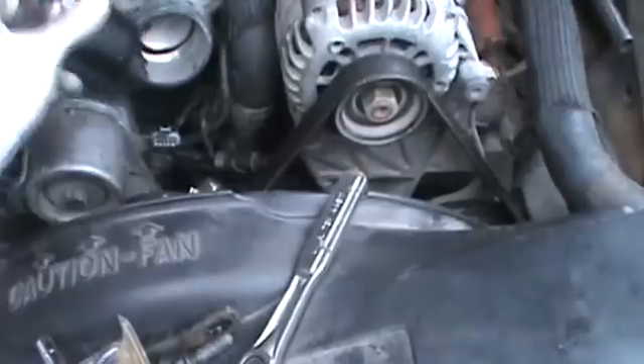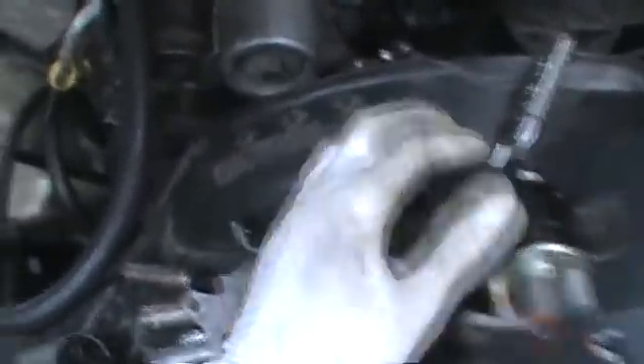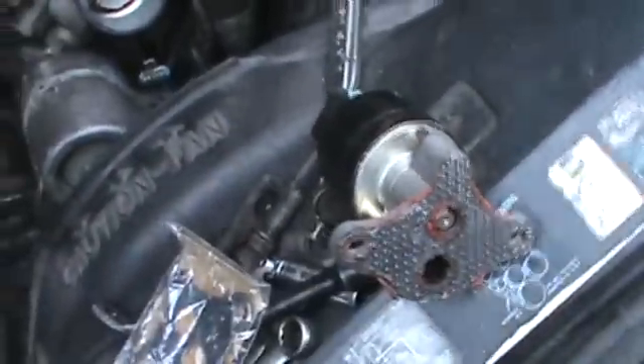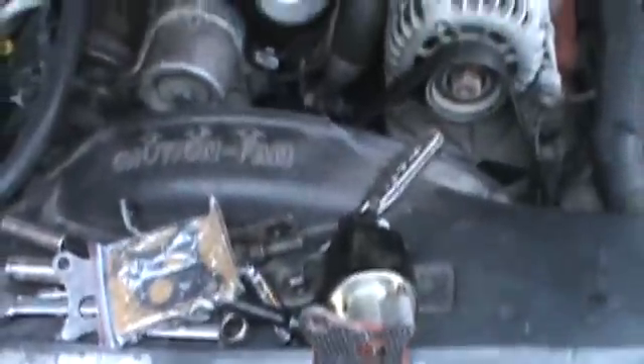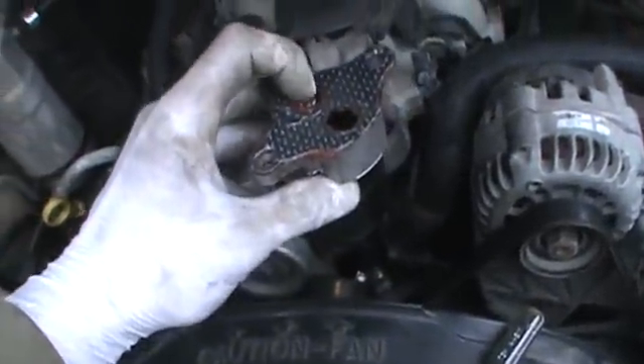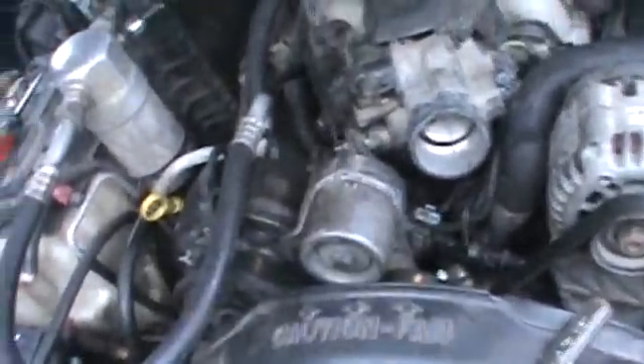You plug this thing up while the car's running and just sit it right here. While the car's running, you'll see this valve right here. You give it some gas — this is your throttle body, you can pull it to give more or less gas — and you'll see this valve open and close. With this customer's car, I took it apart, had it running, gave it gas, and you want to see this valve open and close. It doesn't, so we know this EGR valve is toast, or the signal is toast.